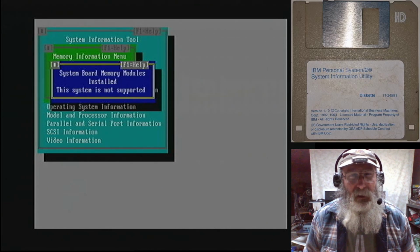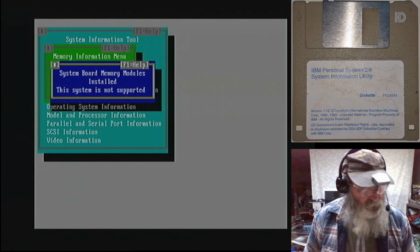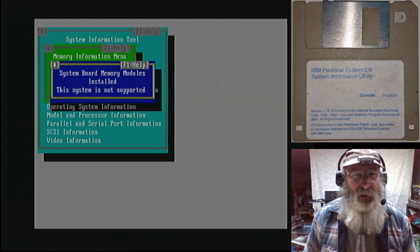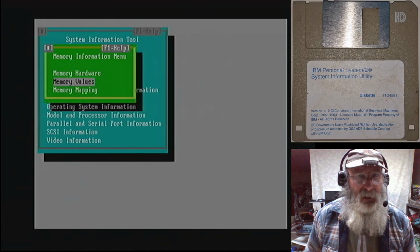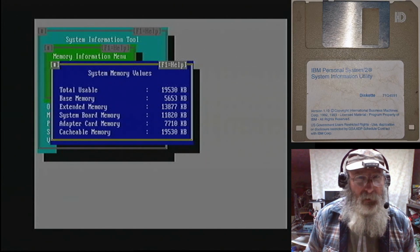And then on the microchannel SCSI adapter, this caching SCSI adapter called the Spock, it can also use those modules to beef up the cache memory on the Spock. I'll be showing the Spocks later on. In the video I went through earlier, showing the SCSI cards I got from Japan, from Sandy, some of those had cache, but that's soldered onto the cards themselves, so not a replaceable SIM. You can't upgrade it. So we hit on the first thing that's not supported on the system, and then there's some information just on the system memory there. I don't think I have any sub-windows.